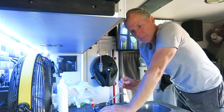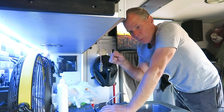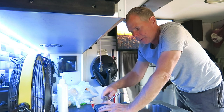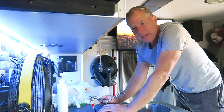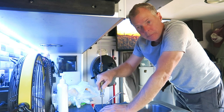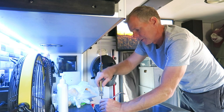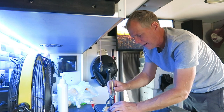And the corrosion from water getting into the switch had, I guess, worked its way back into the copper elements and made that wire so brittle that every time I tried to strip the insulation, it would just snap the wire. Finally, I was able to get it stripped and keep about half of the copper, because I just needed to get it working again. I got it working and triple taped it all back together. And like a day later, it just stopped working again. So I take it back apart, and the job that I had done wasn't good enough. I didn't have a good enough connection.